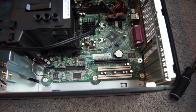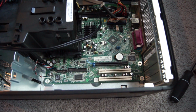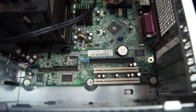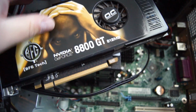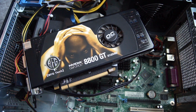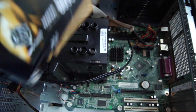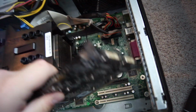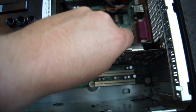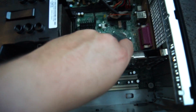As it turns out, the only card options I had on hand was a Radeon 5450 or an NVIDIA 8800 GT. And since all the games I planned on testing were DX10 and below, the 8800 GT became the clear choice. It was safe from that 25 watt PCIe slot limitation, as most of the power comes from the 6-pin PEG connector.